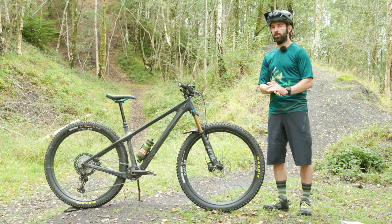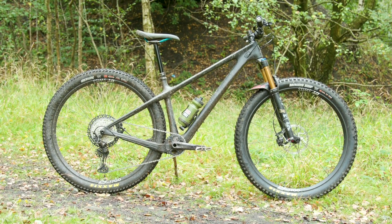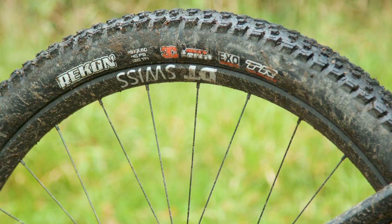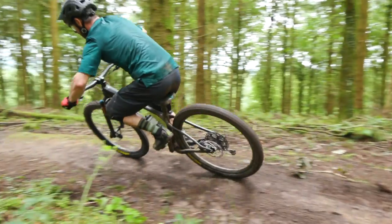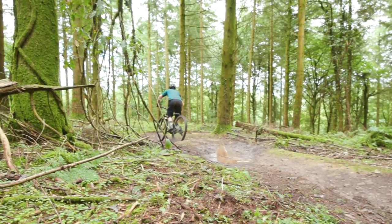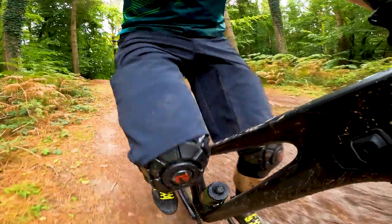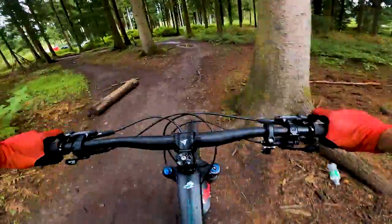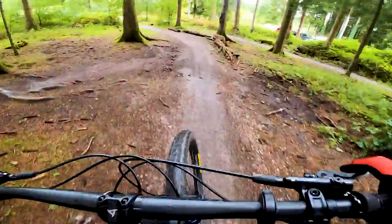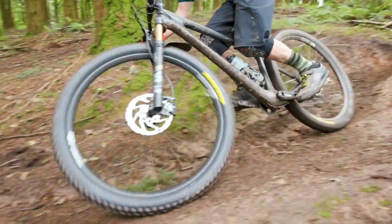As any tester would, I'm going to be fairly picky about the spec. The first obvious change for me would be the Recon tire at the back — not a bad tire by any stretch, but living in the UK where it's a swampy island for six or seven months of the year, there simply isn't enough bite on that tread to get through winter. I love how fast it rolls, but as soon as things get muddy and boggy it just lacks braking traction. I'd swap it for something with a deeper tread to give more confidence on steeper trails.